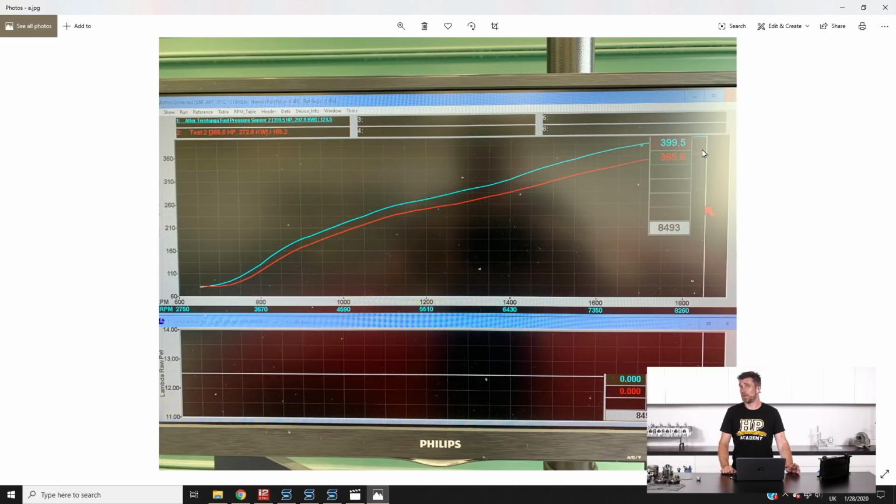In particular here, I probably did 8 to 10 runs, making a few tiny changes here and there, and every single run was consistent, one on top of the other within a few horsepower. We also had an incredibly hot day while we were tuning it. So here we're right in the middle of summer in Queenstown. So some of it we did put down to the heat of the day. Wouldn't account for 20 horsepower, but yeah, there you go. So that's why it's a good idea to take note of where your engine power is, and if it is trying to tell you something.